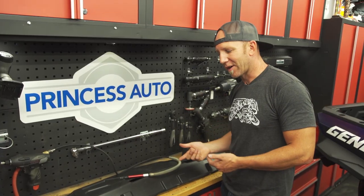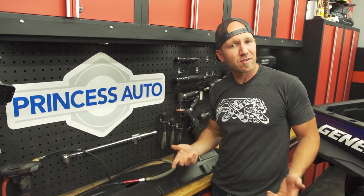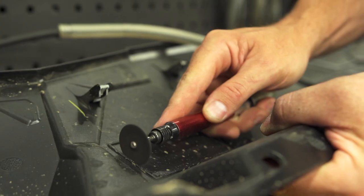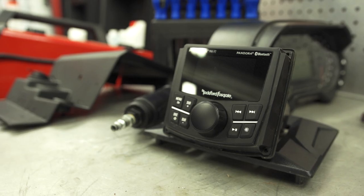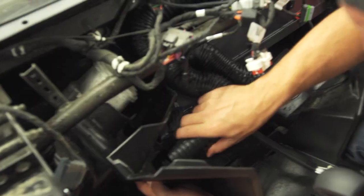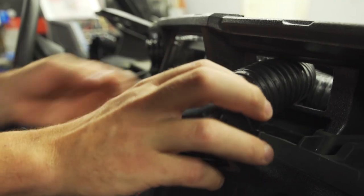There's a lot to remove to make this heater kit go in, but Polaris has made it super simple to install — simple enough that I wouldn't hesitate to suggest you give it a try at home, as long as you're relatively handy in the garage. You'll feel a little strange cutting into the plastic; it's a bit unnerving the first time, but when you can visually see the marked and recessed areas that coincide with the instructions, you'll know it's the right spot. While this will take you somewhere around four hours to complete, I was able to get the job done in much less than that and didn't struggle with any areas in particular. The finished product looks great, seems like it's right from the factory, and blows out air with impressive force. I think the kiddos will really appreciate this on those early morning rides or late evening and nighttime adventures.